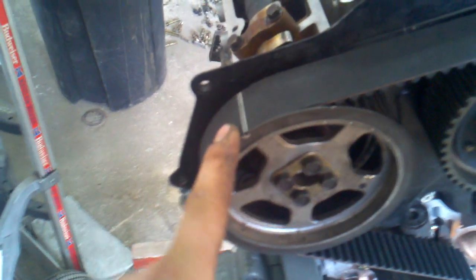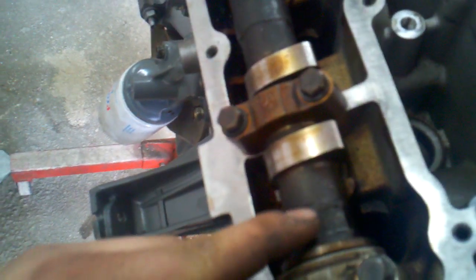All right, so then you move to the exhaust cam on the same passenger side head. Do the same thing. There's a 1-inch key right there. It's just built like a nut onto it, shaved off so a 1-inch wrench will fit over it perfectly. Or 24 millimeters is probably correct, but anyways, a 1-inch wrench will fit there. 25.4 millimeters is 1-inch.